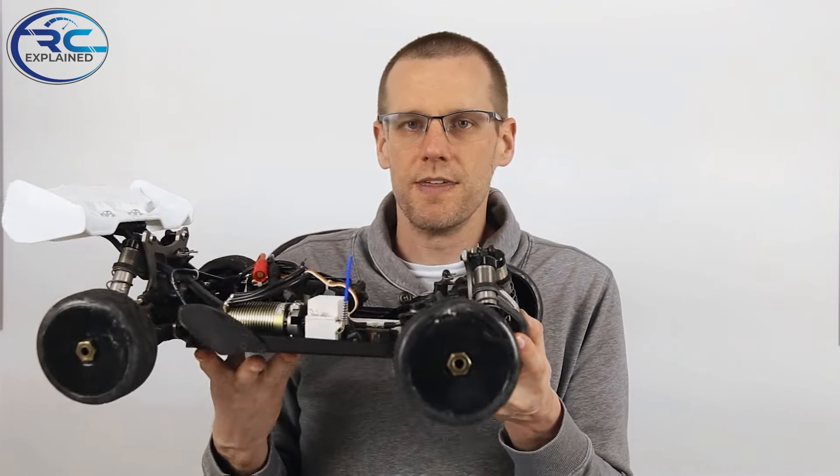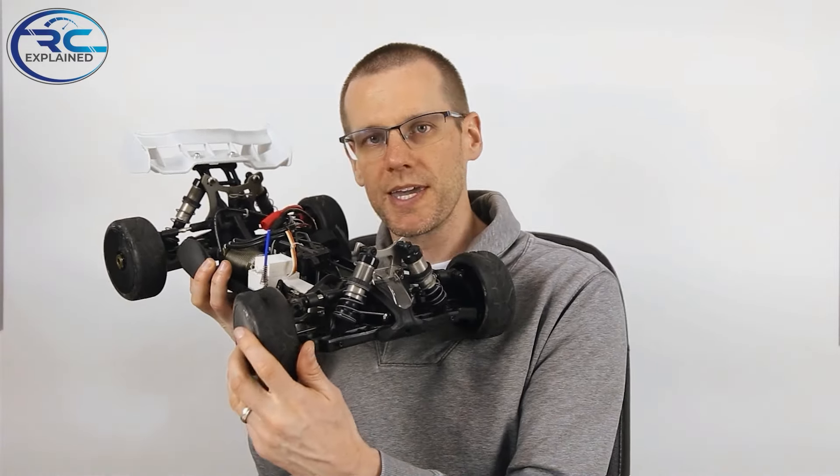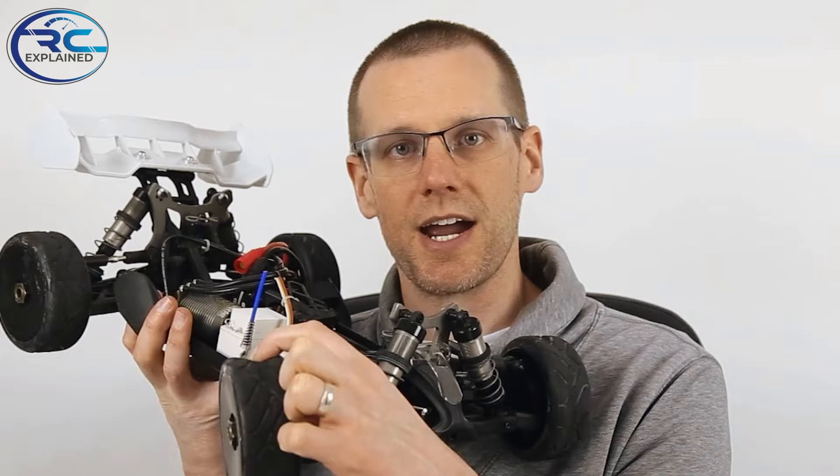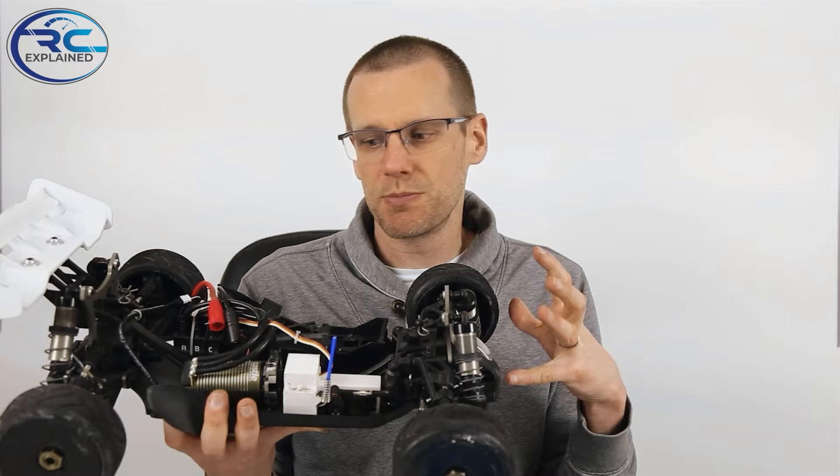Now there are a few reasons why you'd want to actually do this. I have a radio controlled vehicle right here with me and this vehicle is a 1:8 scale buggy. One of the biggest things you might be able to pick out in the video is that my tire has ballooned, causing some significant damage to the tire on the front end of the vehicle. So I want to be able to control that wheel spin in the front by sending more power to the rear, and that's why we want to lock our differential within this video.